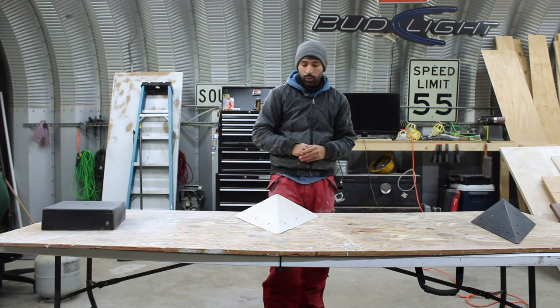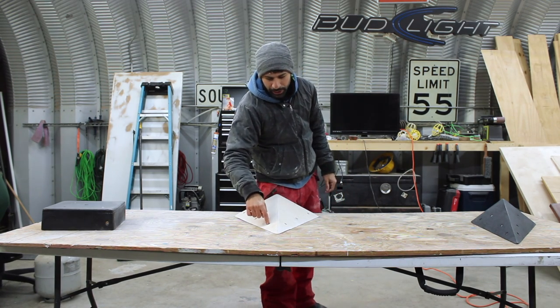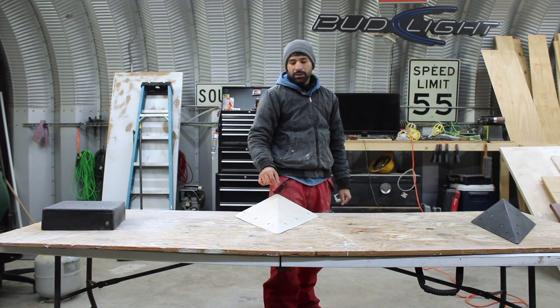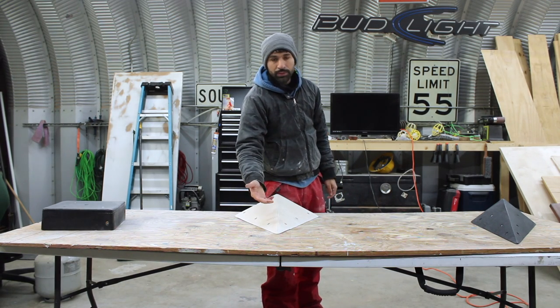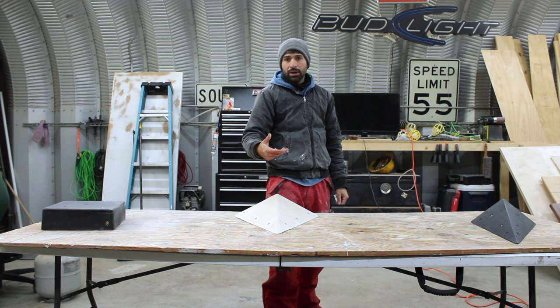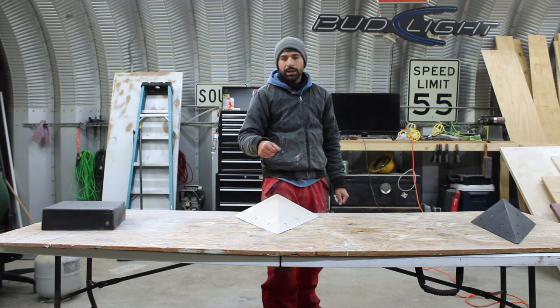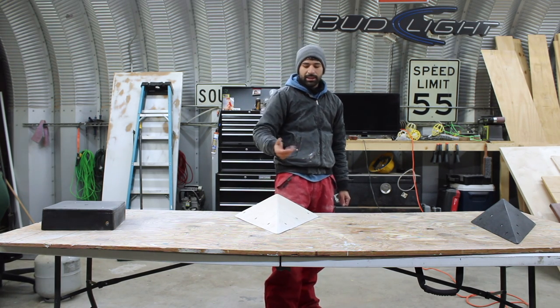And one more thing that I did forget is to make sure that you can stick your volume inserts in and they will go all the way through. So if there's fiberglass on those edges to where the volume inserts are, you want to take something and go ahead and remove all that excess fiberglass that's covering it.